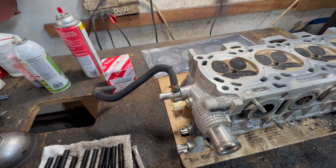Over here this flat part is pretty much flat with this part, so you just line it up from there and then just drop it down. Another thing you want to do — take one hand here and one hand diagonal here, and put pressure on both sides to make sure it's not rocking. It shouldn't rock. Also make sure the seam is nice and tight, laying nice and flat all the way around before you start putting your bolts in. You want to make sure it's seated perfectly, nothing's in the way — because as you torque it down, if there's a little piece of material you didn't see, it's going to leak.